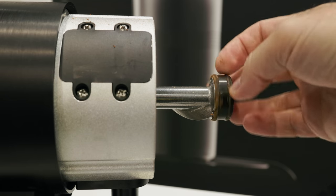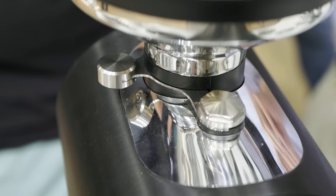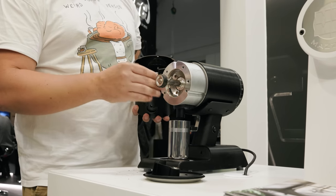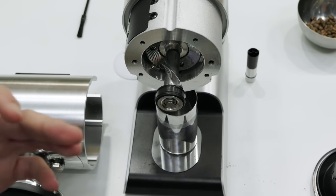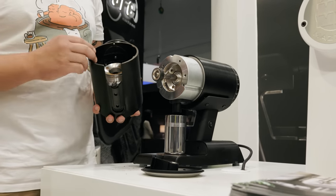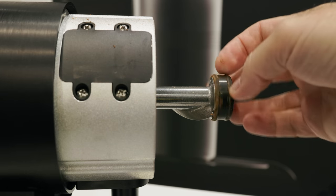There is also an auger that acts as a pre-breaker — something most other grinders don't have. Uniquely, it doesn't go all the way around the auger, only about halfway, which really slows down the feeding from the hopper into the burrs themselves. This allows for more metered feeding into the burrs to give a more consistent throughput. These burrs definitely suggest something optimized for more consistent light roasted coffees, though I haven't had a chance to try them in a way I'd prefer in order to fully comment. We'll leave that for a later video.